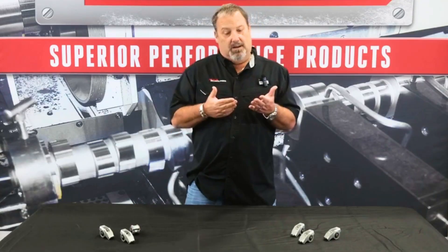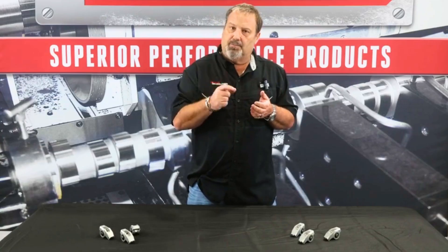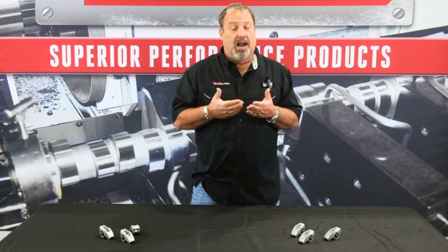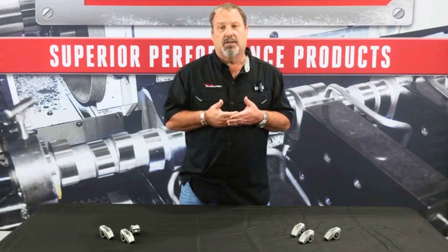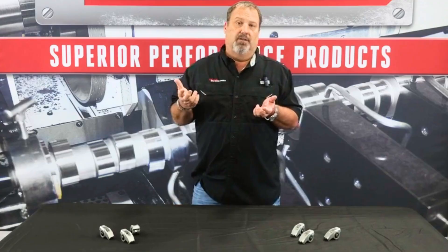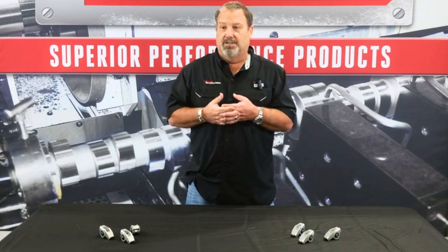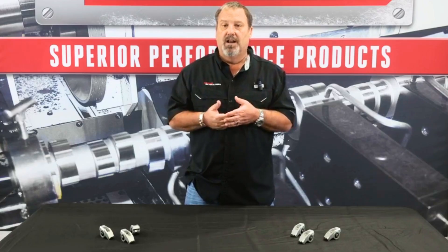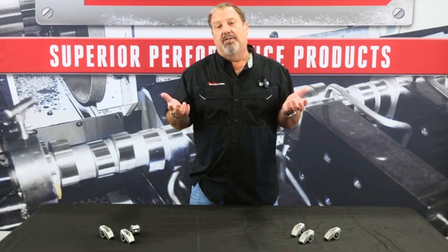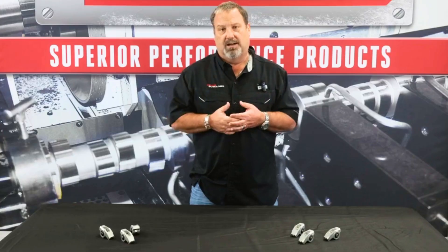What's this going to do for you? It's going to prevent valve guide wear. If your sweep pattern is perfectly centered but 120 thousandths wide, I can guarantee you within 1,500 miles it's going to knock the valve guides out. It's going to smoke like a freight train — your neighbors will love it if you've got mosquitoes, but it's embarrassing at the rod run. And it's going to empty your wallet because now you've got to repair the heads, possibly replace valves. I've even had customers drop valves into engines, costing them thousands of dollars to repair.